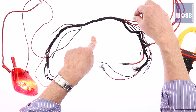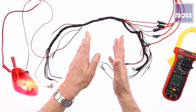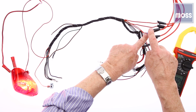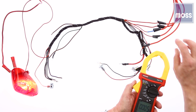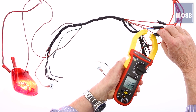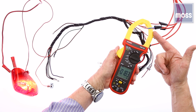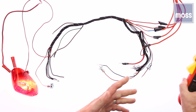When I get to the wires at the end, one wire with the one amp is going to go one way, and our wire with the tad less than two is going to go the other. And perhaps the nightmare of nightmares — we're following one red wire into the harness, and what if it goes one, two, three, four, five red wires? Let the meter do it. I'll just pick up the first one — that's certainly not a tad less than two amps. Let's pick another one — not a tad less than two amps. This one with the blue tape, this is it. We can identify this wire from all the way from the beginning all the way to the end because we know how much current is going through there.